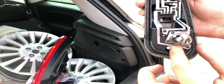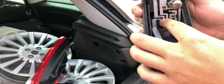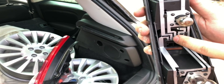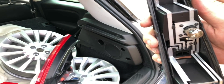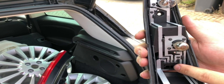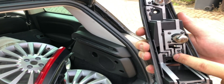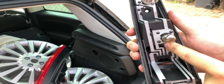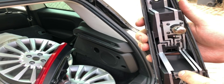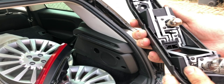Now you can see the bottom one which has a lane to the most left one — that's the brake light. The second prong goes up top, so that's the indicator light. You've got a fourth one going to the middle and the bottom bulb, which is going to be your LED wire for the Evo version.